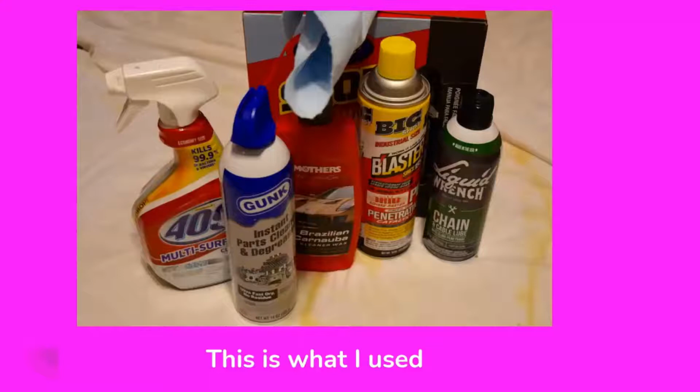Now, these are the products I used on that green bicycle. I used plain old 409 to clean off a lot of the dirt. I used Gunk parts degreaser to get that old sticky, nasty grease off of the bearings and the chain. PB Blaster, I think that is a much better penetrating oil than just about anything on the market. If you have fasteners that are corroded together, soaking them down with PB Blaster is going to loosen them up, if